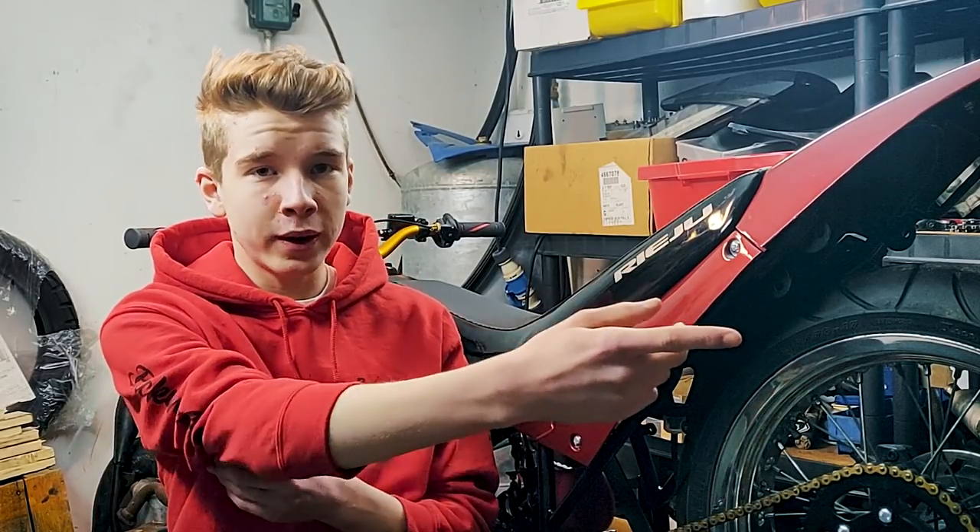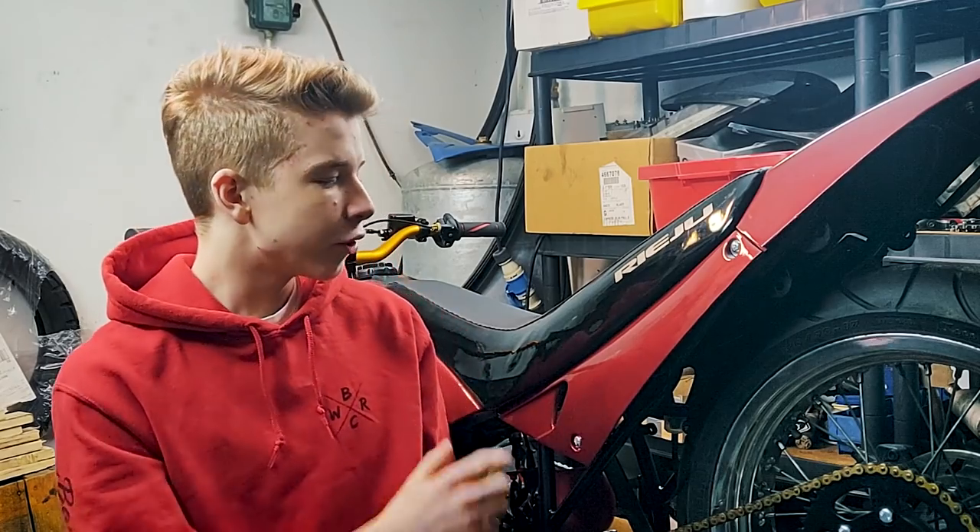After priming, we used real car paint from a store in Sweden. Car paint is way better than rattle cans or anything like that — get real car paint, you can get it in spray cans. It's worth it, it's gonna last. My red derby right here on the side — we didn't use clear coat and the paint has held up really well. But I do recommend having a good clear coat as well.